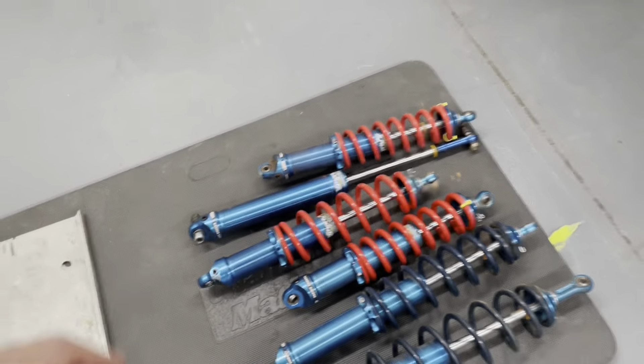I got his Camaro tuned up pretty good — set the floats and the idle. It probably needs a rebuild; the car was likely sitting for a while. It's got a Holley 650 on it, similar to what we run on the late models. It's got a 350 small block, bored 30 over, a good cam in it — you can hear it. It's got wide tires on the back, skinny up front. It's a drag car with a fuel cell in the trunk — they cut a hole and put a racing fuel cell in there.